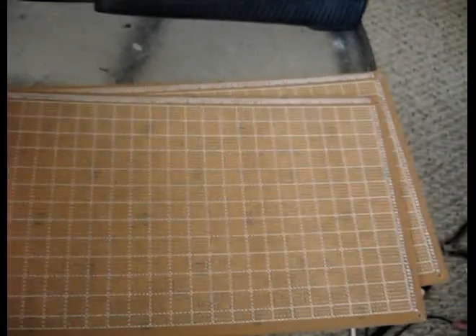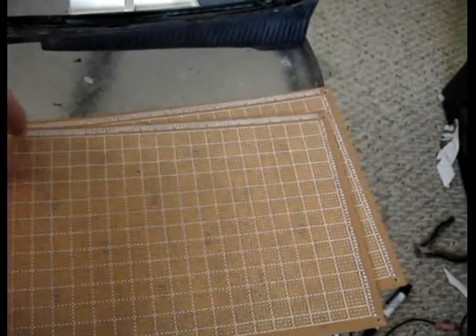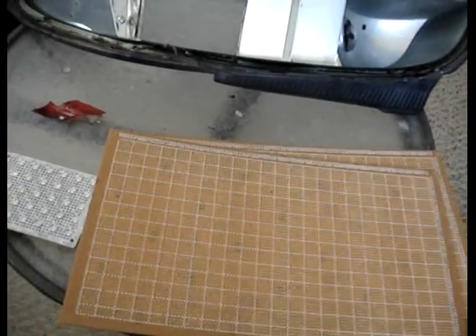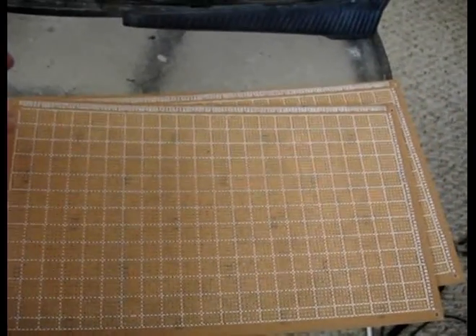So these I'm going to cut into thin strips — probably about an inch and a half, maybe an inch — just cutting off the side, and then wiring in LEDs, all my yellow LEDs. Wire them in parallel. It's going to be nice when it's done, because the diffuser lens is taken out for the turn signals, and the backup light is going to be the same way.